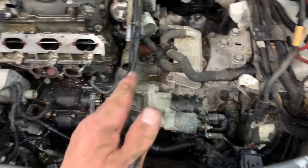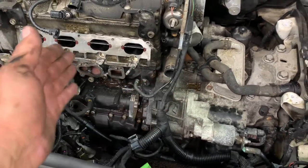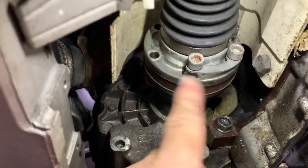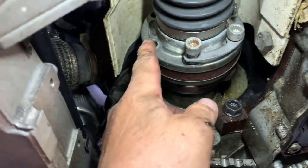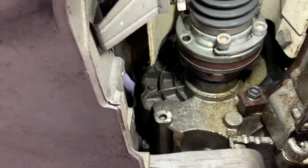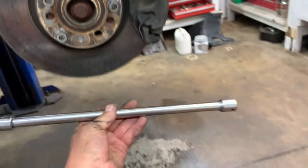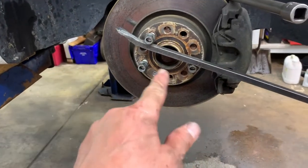This stuff over here is for the water pump, so I'm keeping things separate. Now we're going to raise it up and finish underneath. Clamp the right half shaft and get all the bolts started — make sure you put these little retainer clips in the right spot. Get them all started, snug them up all the way around. The axle shaft bolts are M10. Use long extensions — two of them — go through the wheel housing, snug them up and tighten them.